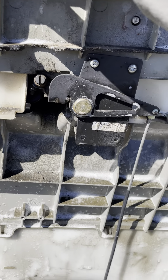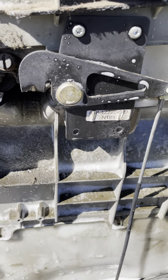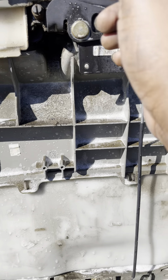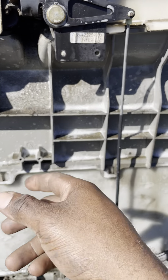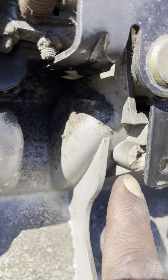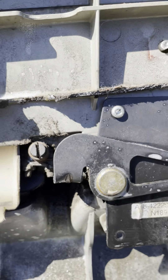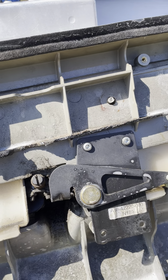So I'm going to show you all what the inside of this mechanism looks like, if any of y'all have issues with the truck like this. This is what it looks like with the door panel off. Mine — I can see why it was hanging in the door. These both are broken off. You can see back here, these are plastic — they sheared off. They were already broken, so this was just hanging inside. That's why the door wasn't working.